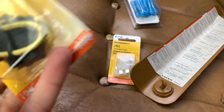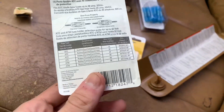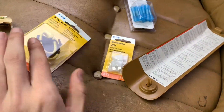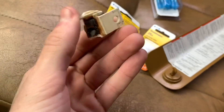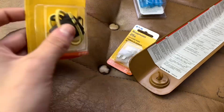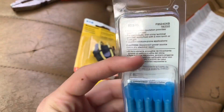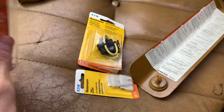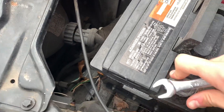One trip to the auto parts store later — we got a 25-amp fuse holder. There was a 30-amp fuse in there, and I've done a bit of research. It looked all corroded inside, and I looked back at my earlier videos and it already looked kind of melted. I think there was just some corrosion in there because this is not by any means a waterproof fuse holder. So I got a splash-proof one here, some new 25-amp fuses. I got a couple of butt connectors that also heat shrink. And since we're working on wiring, we of course want to take off our negative terminal.